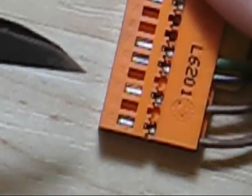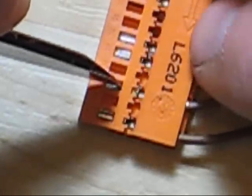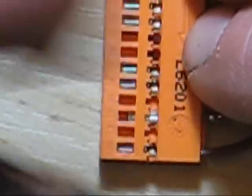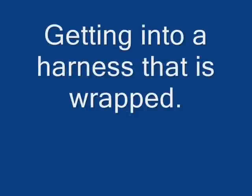You can see there are little openings where the barbs are poking through and they're spring-loaded. I can use the tip of my knife to push the barb down, and once I push the locking barb down, I can then slide the terminal out of the terminal housing. For these, there's no special tool needed.